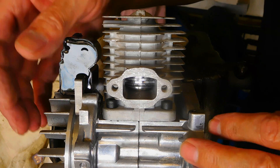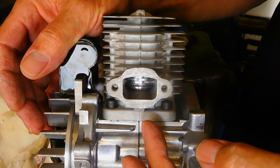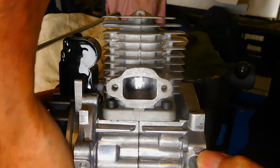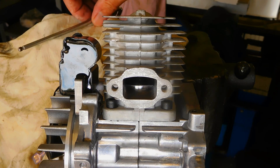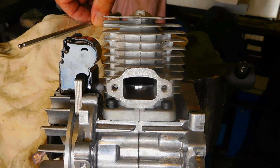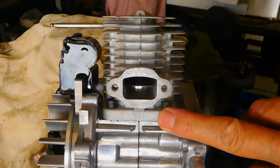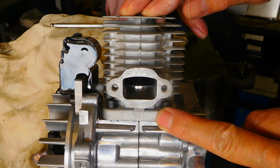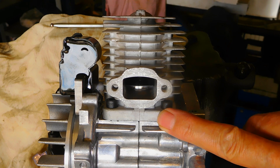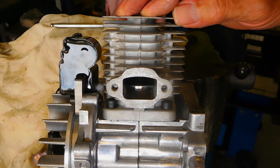The first thing that's wrong with this engine — there are two main faults. One is that the small end bearing sort of hangs out each side of the conrod. The other problem is that this piston just doesn't go anywhere near the bottom of the port at bottom dead centre. A couple of things we want to measure is the piston clearance from the top of the head, because this cylinder head is not removable. I'm going to show you a quick and easy way to measure the piston clearance from the top.